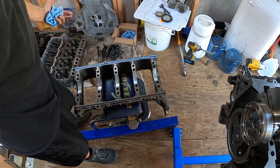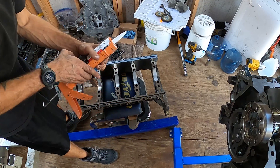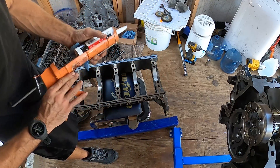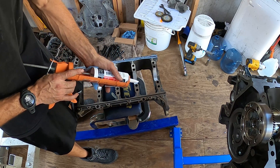This isn't rocket surgery, dude. You're just putting caulk on. If you've never put caulk on before — cut the tip, poke the end of it with the metal piece from your caulk gun, and then slowly put a small bead on there. It's easier to put more than it is to take off.